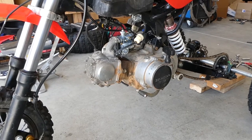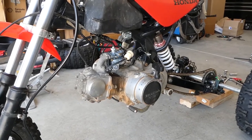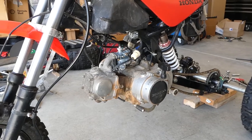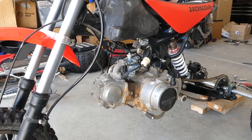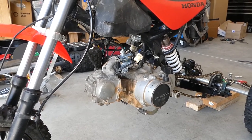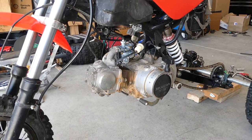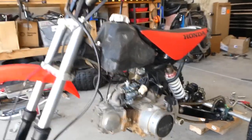The engine is smoking a ton and I don't know why — it's way more than if it was just some oil in the exhaust burning off. So I'm probably going to have to take it in and see what's going on: valve adjustment or bad rings on the piston, who knows. This is a secondhand motor that we weren't even really able to test run when we bought the ATC it came with. He didn't care because he was going to pull it and put a bigger motor in anyway. So if I have to put a little money into it, that's fine. If it's going to be a ton, I'll just pull it and throw a Piranha 140 on there or something. I'll set up the time lapse and just keep plugging away so we can at least get this thing to a point where we'll see what it looks like all finished up.